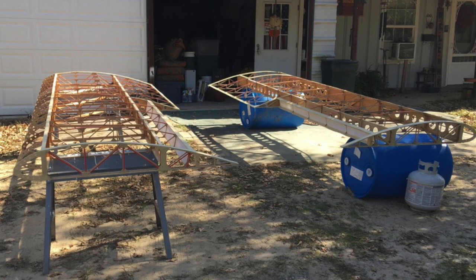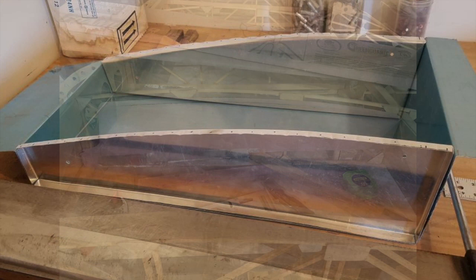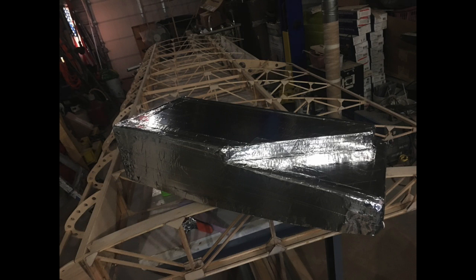On to the fuel tank. At first I was thinking of building a fiberglass tank, but decided to go with a riveted, set-on-top wing tank using a ProSeal type sealant — more to come on that. Here are some pictures of my pattern made of scrap foam and prep of the wing cavity. On the next video, I will show you the wrapping of the nose and finishing touches getting ready to cover both wings.